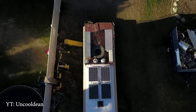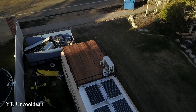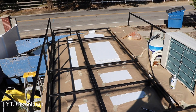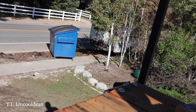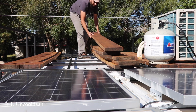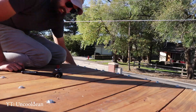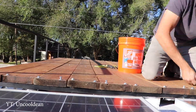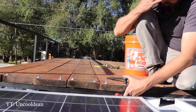For instance, my friend Dean built a pretty robust deck on top of his bus. It was kind of pre-built and then laid on top and bolted through the ribs of the bus, which gave it a nice top profile. It was really secure because it was actually into the ribs of the bus — by putting the bolts through the channels of the ribs, he essentially took the deck and bolted it directly to the frame, which made it one solid piece.